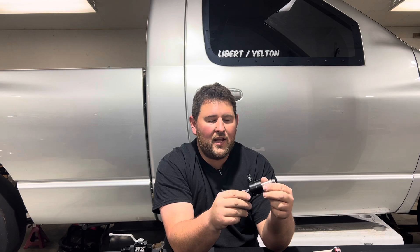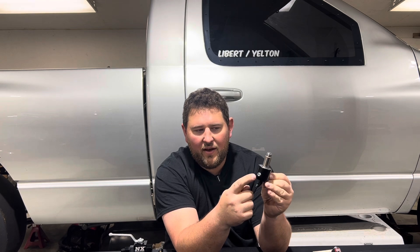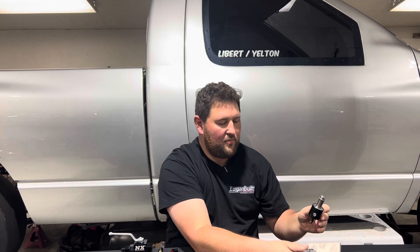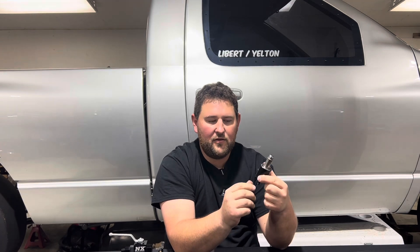This is where you're going to run one or multiple of these for down-track stuff if you're really trying to use a lot of nitrous to speed the truck up. These are almost always — regardless of manufacturer brand — quarter inch MPT inlet and then eighth inch MPT outlet. That's pretty standard. They also have an eighth inch MPT fitting for the purge — that's what the 'P' stands for on it. You can basically union a purge solenoid directly to this solenoid, so that when you purge it, you're purging all of the air between the bottle and this solenoid. They make these in a variety of different sizes — .120s, .136s are about the largest common ones, and I believe NX makes what they call a .375 solenoid.